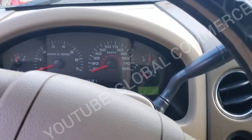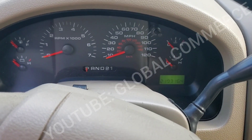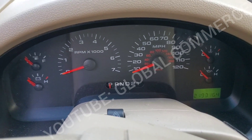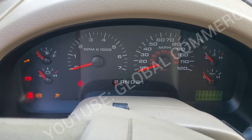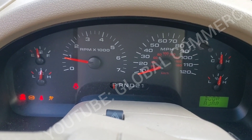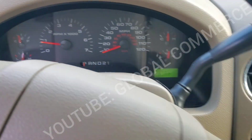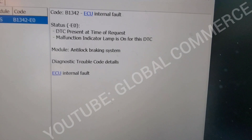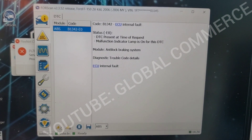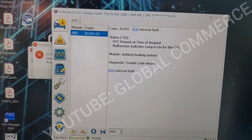So that's going to be it for now. There might be a part two if the customer wants to proceed, but it's going to require a replacement of the ABS module to solve this issue — it's confirmed to be an internal fault in this module. The VIN mismatch error is gone, as you can see. After cycling the ignition off and on again, all we've got is the internal fault.